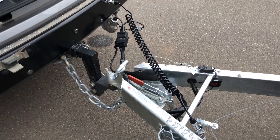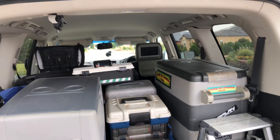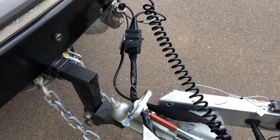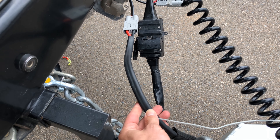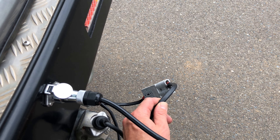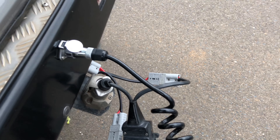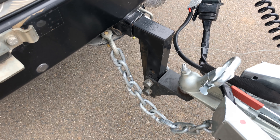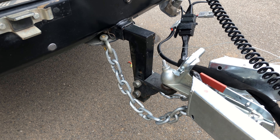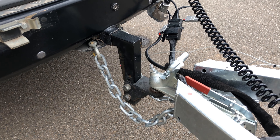There's a lot of cables going on here so I'll explain what they're all for. This is the camera cable for the back of the camera — it goes up and you can see the front of the car there on the windscreen mirror, that's where the camera comes out. Then we've got a dedicated Anderson plug six gauge going directly to the battery, then another Anderson plug clipping in here that's running the fridge. So my fridge is running with two batteries in the van and another two in the car all hitched up. Ideally I would have crossed these chains over but because the car is so high I've got to use this special hitch so I can't cross them. But if you can do that you should — so if it does come adrift and the coupling comes off, it'll fall in the cradle of the chains being crossed.